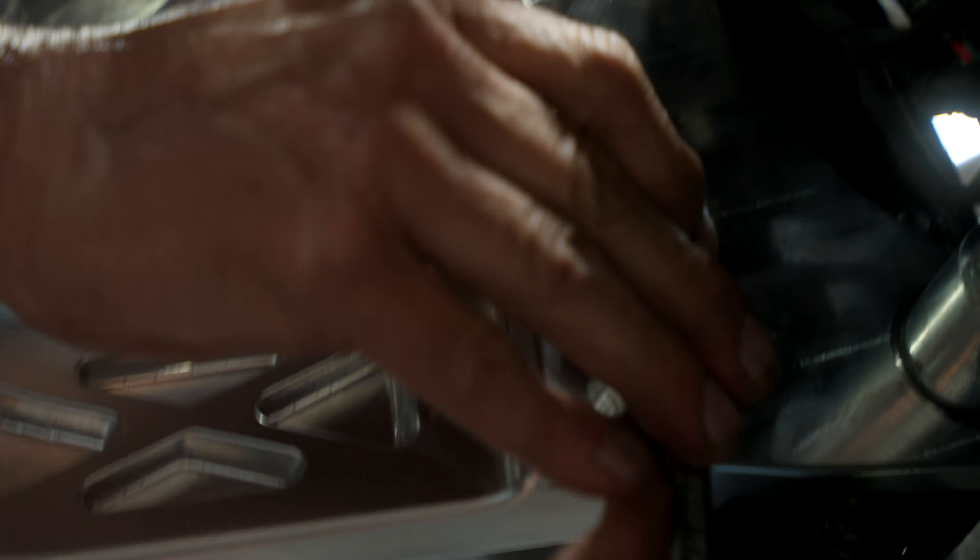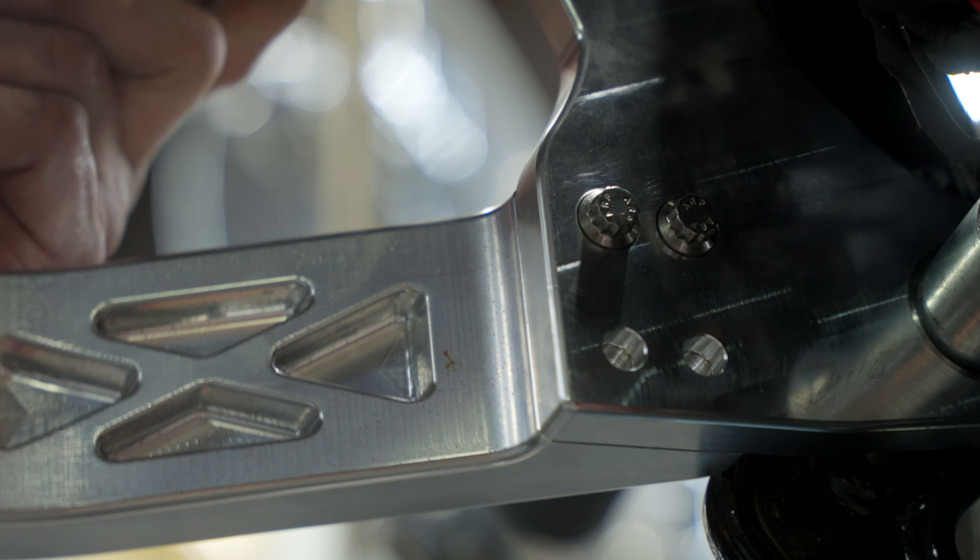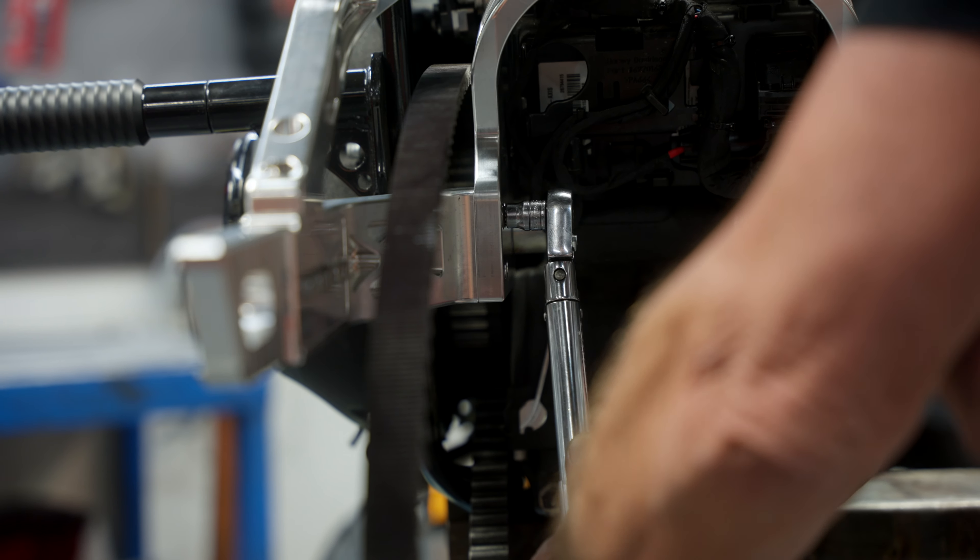It's helpful to put a little wedge under your transmission to support the driveline so these pivots slide in easily. Once in place, I'm going to torque those inner bolts on the left side.